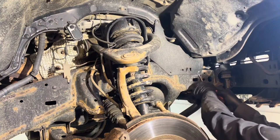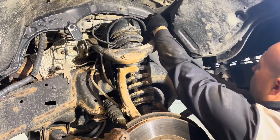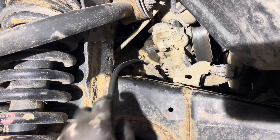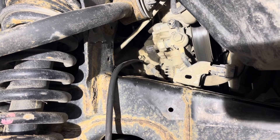This one here is missing, so we just have the front one — there are a few clips you've got to pull out to get it out of the way. Install a 5/16th of an inch diameter hose on the drain nipple located on the side of the engine block on the passenger side.